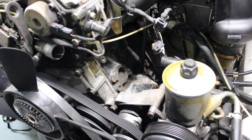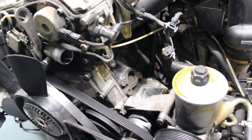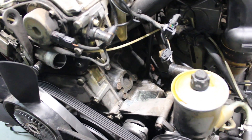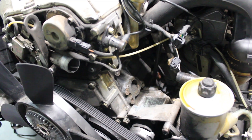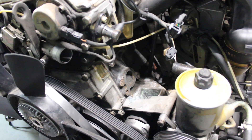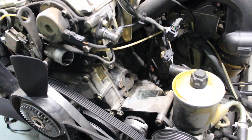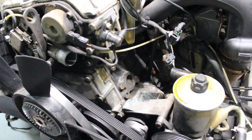We have the water pump out now — super simple if you follow the instructions from the last clip. Once I got the water pump out, I cleaned up some coolant that was dried up in here from the previous water pump replacement back in 2005. I also cleaned up the sealing surface with some scotch bright just to make sure any corrosion on the inside of the o-ring area won't impede sealing when I install the new pump. Next I'm going to get the new pump, install the seal kit per Mercedes terminology, and then reinstall the water pump. Let's take a look at the new pump and the old pump and go from there.